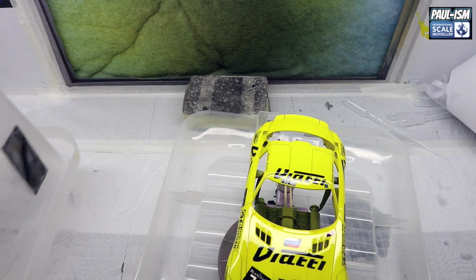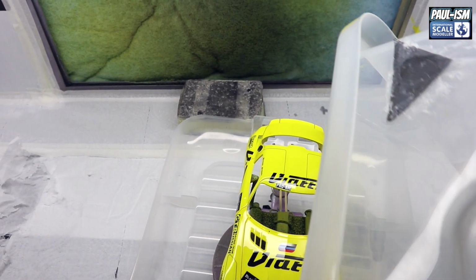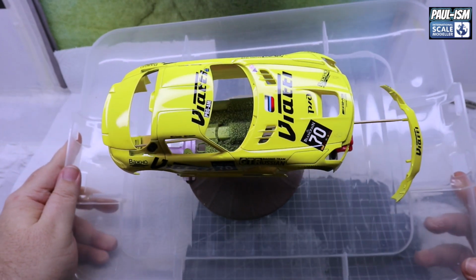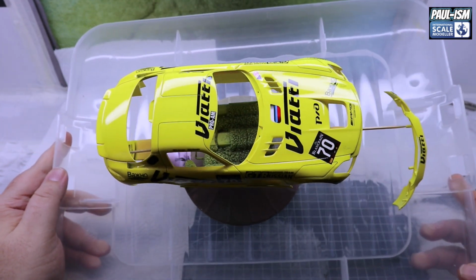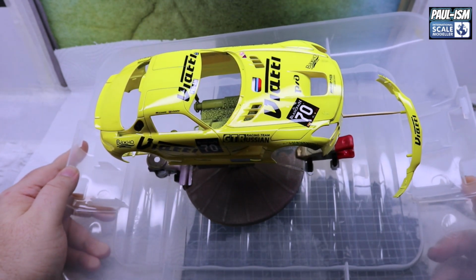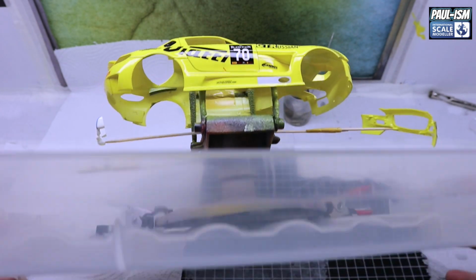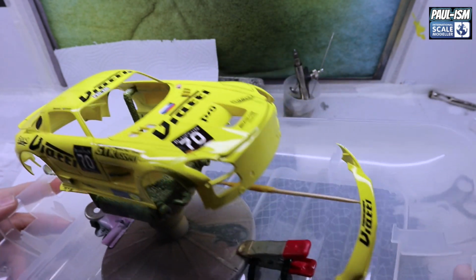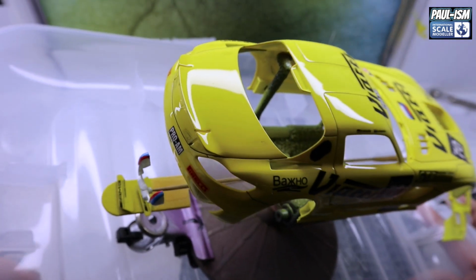So we've got vents in the side of the cover. I've drilled holes and put some Tamiya mesh over, so there's circulation. And for the first few hours, I propped the front up just a little bit to make sure it could off gas properly. And there we go. This is after about 50 minutes. We just get out to have a quick look. Absolutely beautiful 2K clear. The colour is absolutely popping now. Other than that run and a few spots of dust, it's absolutely perfect. It's going to look absolutely beautiful when it's finished. So really happy how that's gone.